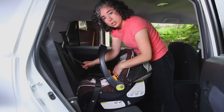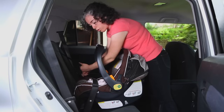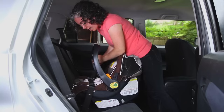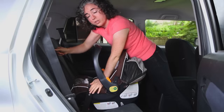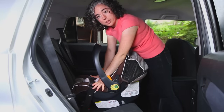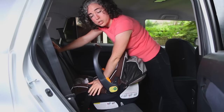You're going to be pulling on the shoulder belt. The best way to pull it is taking your hands under the handle here, not around. So grab the shoulder belt and pull it towards you. Aim for your belly button. Use your thighs to push the seat into the back and wiggle the seat side to side. All of this slack you're then going to forcefully push to the back of the car, right where the shoulder belt starts. If you pull and let go, you've worked for nothing in that it won't get tighter. So pull and wiggle and feed all of the slack up to where the shoulder belt starts.